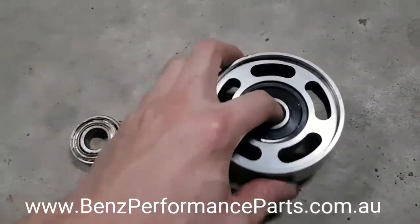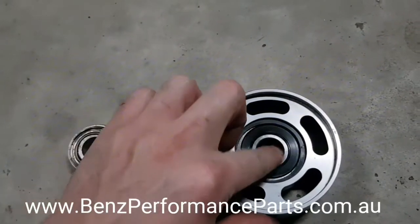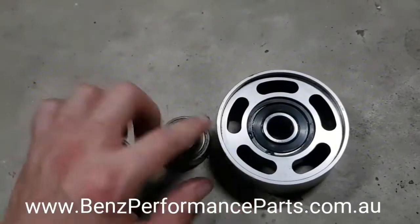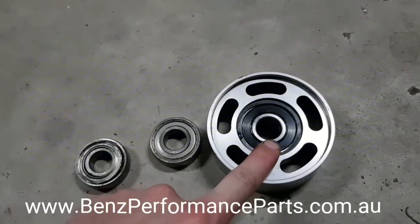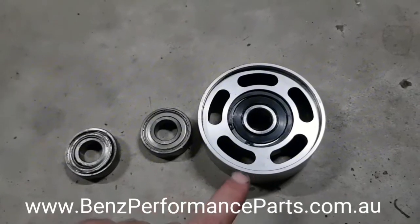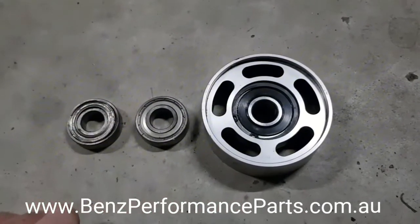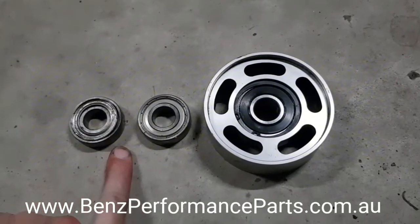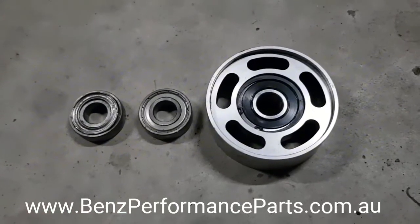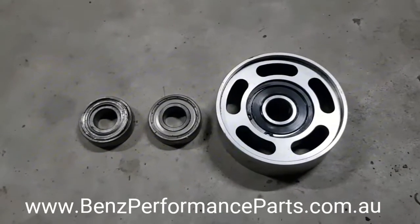The standard bearing has a seal — this is a poly seal and as the name suggests it actually seals the grease in. So even though this bearing has a lower maximum RPM rating, it's still plenty for the application it's being used for in the E55. It will last a lot longer than the shielded ones because it actually has a seal. These came with the belt rack kit and have 20–25,000 Ks on them and they're shot — they're noisy as anything. You can't re-grease them, just throw them out.